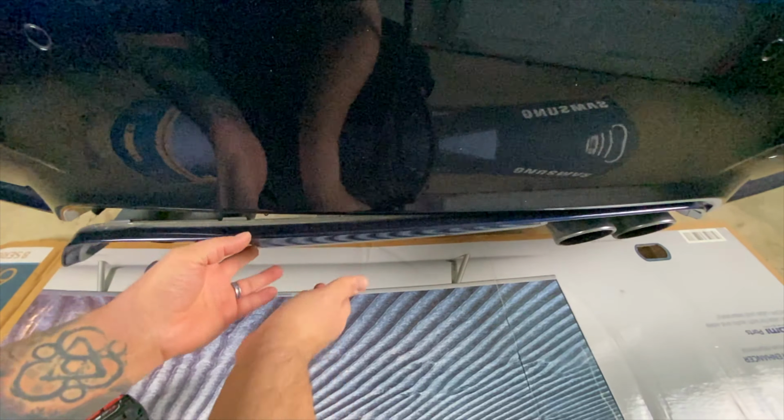Get four of those. And I'm going to be using my driver with a magnetic attachment to hold onto the screw. See, it holds onto the screw so it doesn't drop. If you're using an impact driver, make sure it's one with a quality variable speed, like this Milwaukee. If not, just use a drill. Don't use an impact driver because you're going to strip the plastic.